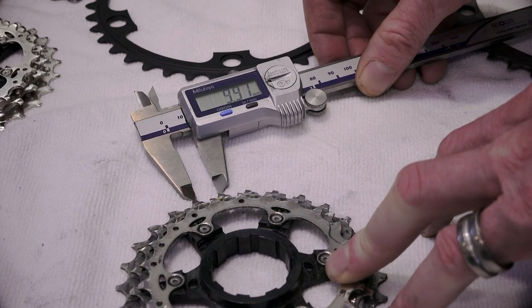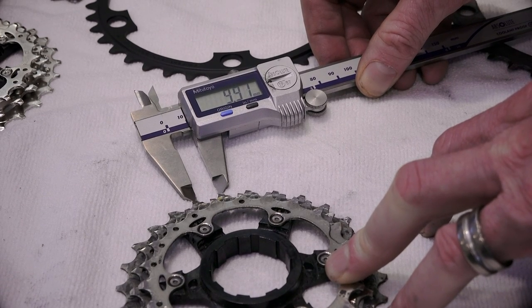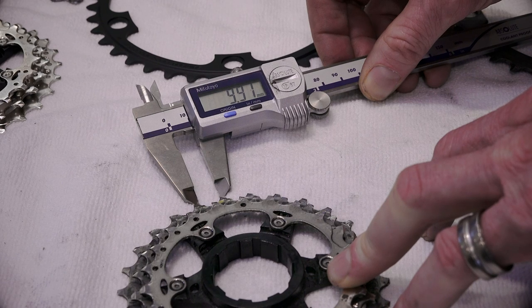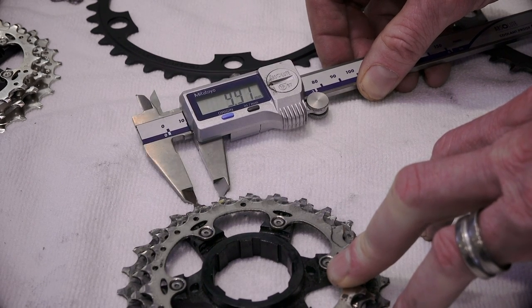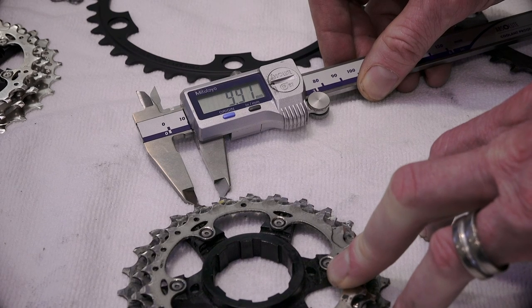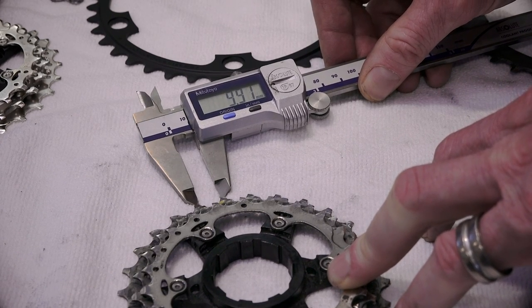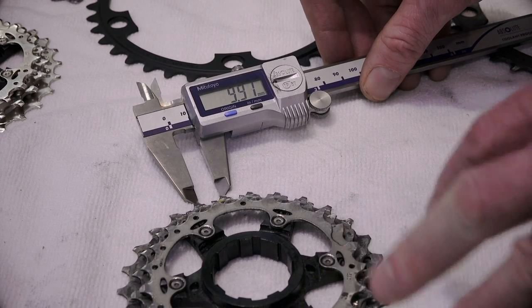If you're not very powerful and tend to ride at around 150 to 200 watts, your go/no-go point might be as late as 10mm, but you really wouldn't want to suddenly become powerful and lay into that cog. As a general guide for Shimano teeth, for most people your safe go/no-go mark is about 9.8mm. It'll be pretty 50/50 at 9.9 to 10mm for jumping under higher loads — especially as you start to put 300 to 400 watts down, odds are pretty high that chain will jump.